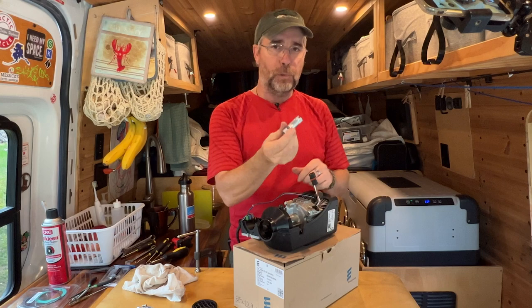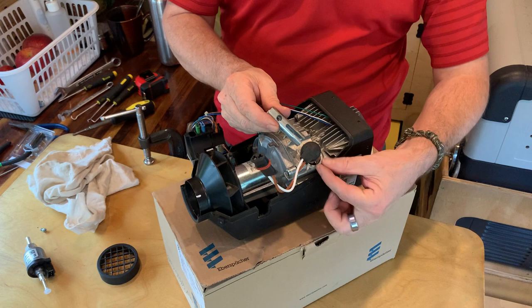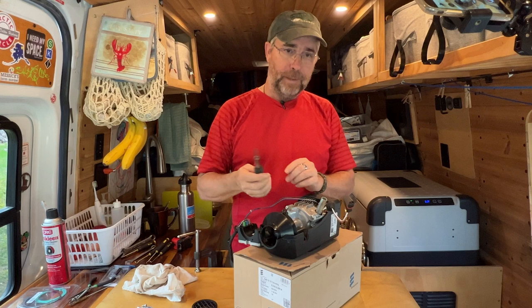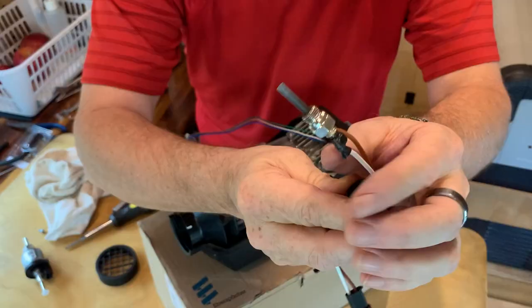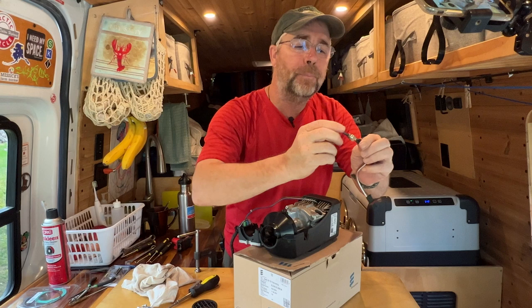What we're going to do is get inside this — this is where the atomizer screen and the igniter are. Get under this rubber boot, then carefully hold the brown and white wires and push the boot towards them. Make sure you hold those wires because you do not want to break them off the end of the igniter. Once you've got that boot out of the way, you can unplug the igniter from the electronic control unit. You don't need to worry about which direction it was plugged in because it can only plug back in one way — it's got a little cutout on the side of the plug.